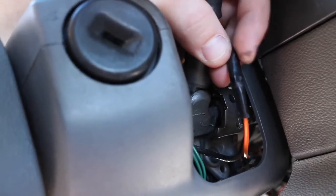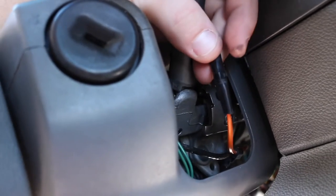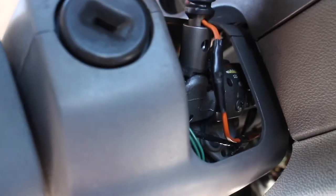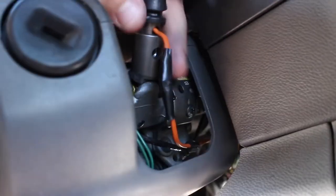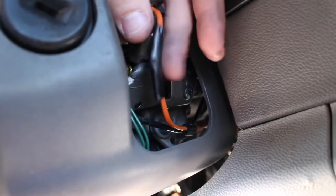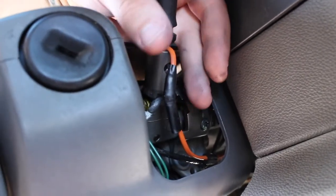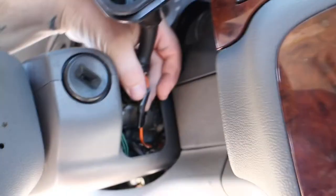It was going to be a little bit of a pain to get in there with the soldering gun, and it's perfectly fine. I figured out what my problem was — they have the wire too close to the steering column and it's tight, so every time we shift it chips the wire, clips it, and cuts it. So that is going to be your fix for this.